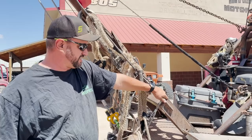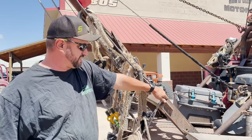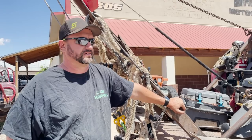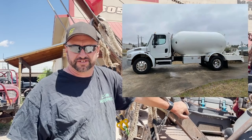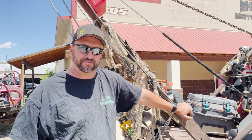So how many winches is that? I have six total — one out each side, three out the back, and one out the front. And what's the heaviest rig you think you could get off the trail? I pulled out a loaded propane truck — that's about as heavy as you're going to have to pull off the trail. I've bent some stuff doing that. I used to have a 15,000-pound industrial winch in the middle, and that job I actually bent the housing in half on it, so I had to get a new winch.